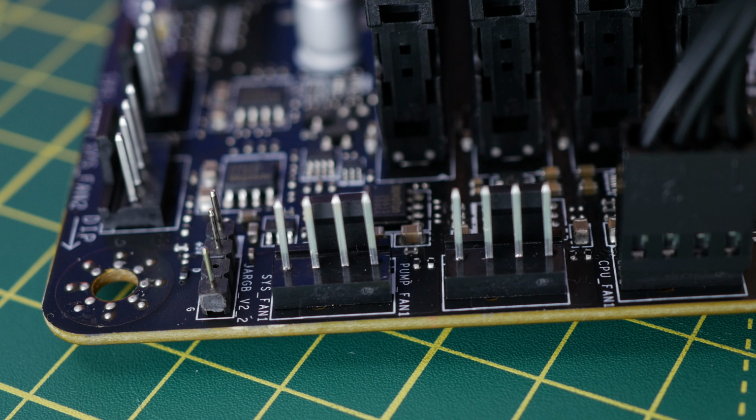But in theory, this is a great bit of kit. Obviously, you need SATA power, so that's the same connection from your hard disk drive or SSDs, and then the other end plugs into your motherboard. But then you just connect all the lighting connections from the fans to this little controller. The system fan headers for the fan speed, you could use fan splitters, or in a minute I'll show you a fan controller as an alternative option.